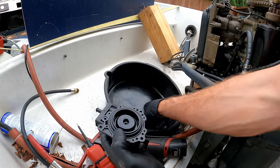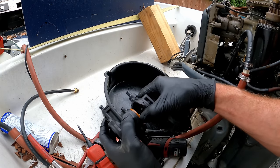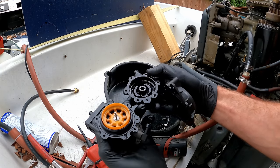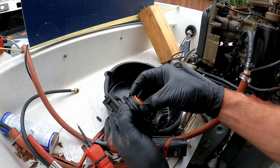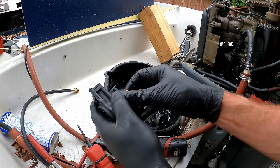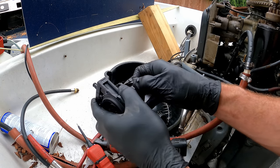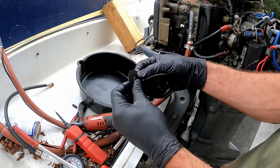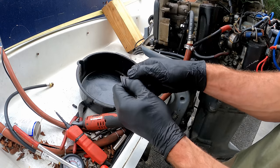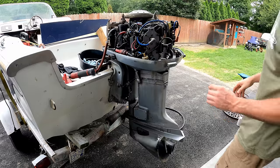And I bet you the only reason this was leaking, because I don't see a diaphragm torn, I think it was just leaking because this hasn't had gas in it in a while, and the rubber diaphragm just wasn't swelled like it would be. And I don't know what these are made of, if they're nitrile or whatever, but this will go in my gas and oil resistant rubber section, because this stuff is tough. All right,